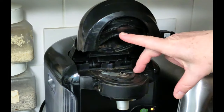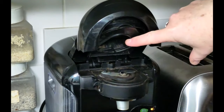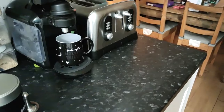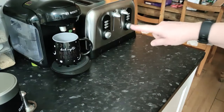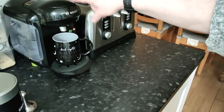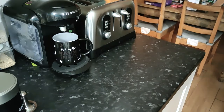If you lift this up, there's a little strip in here — that's where the barcode is read, and that is where you need to make sure it's totally dry when you make the coffee. Put it on the machine. So often if that light goes red, it is because there's moisture on the barcode — that's always what solves it for me. Just make sure the barcode is dry without scrubbing it, and make sure that the reading strip is also dry.